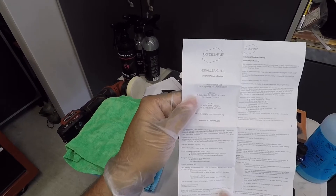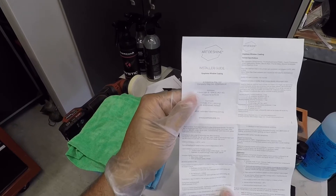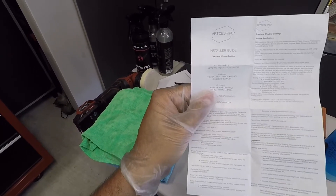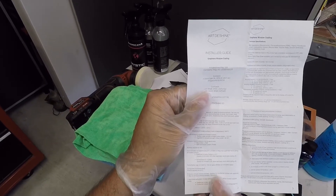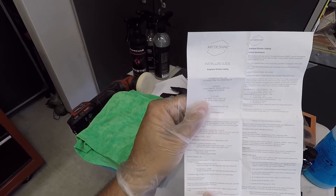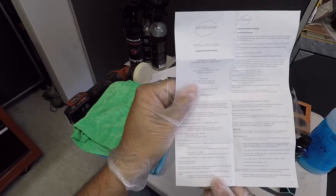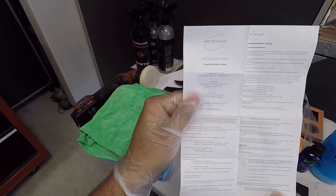Installing on other areas may affect windshield compatibility, which may vary with age, make, model, and wiper type - use at your own risk as wiper chatter may occur. Curing time is five hours surface dry, or two hours with infrared assist. Fully cured is seven days, or 24 hours with IR light, and up to 14 days in tropical/humid or dry/cold temperatures.